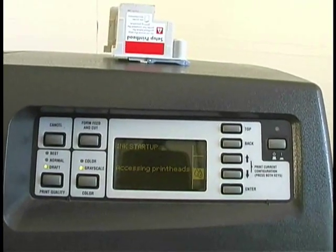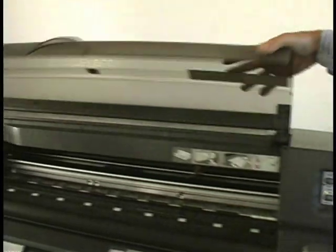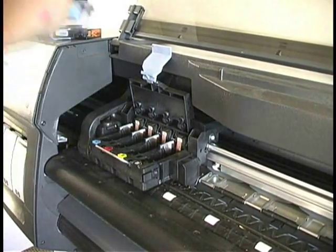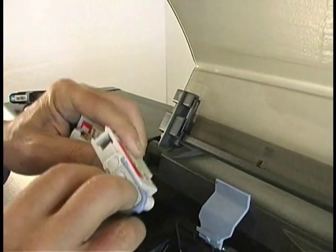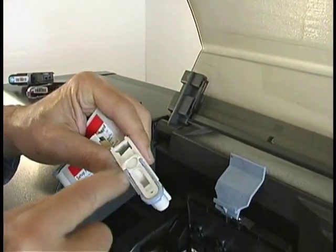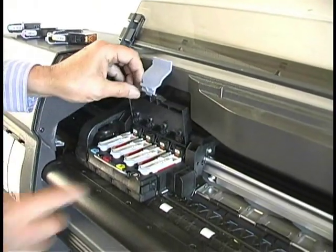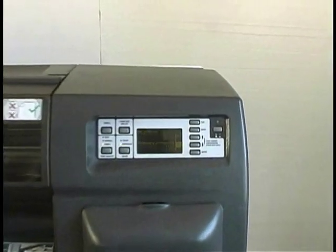These are the setup print heads. Lift the window and install setup print heads. I'm going to remove all of the regular ones for now and put the setup print heads in. Setup print heads have a little chemical valve - it looks like a little cigarette filter down in that hole, and it vents out here. As the air is coming through, it lets the air through, but it's chemically treated - as soon as the ink hits it, it clogs and prevents ink from coming out. This also makes it a one-time use device. Once this is clogged up, it's not going to allow air out again. So we put those heads in, close it up, and we just wait.